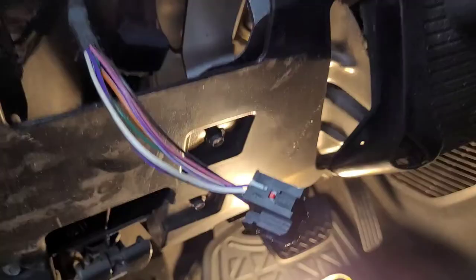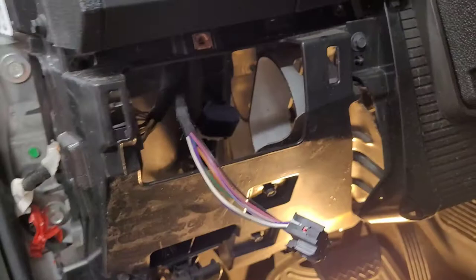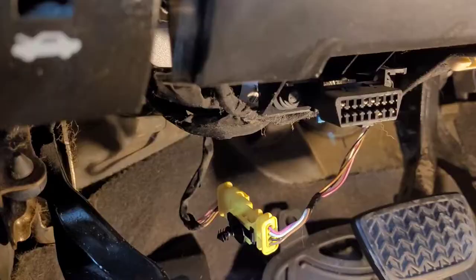It's up inside there. I'm going to pause it and undo the battery on the vehicle. I got the battery disconnected, so I went ahead and unplugged the light switch to get it down out of the way. You can see the amp back in there. You've got the body control module here — it looks like it needs to be taken down out of the way. Don't unplug the yellow thing — that's an airbag — but you can get it out of its little holder if you have the right tool.